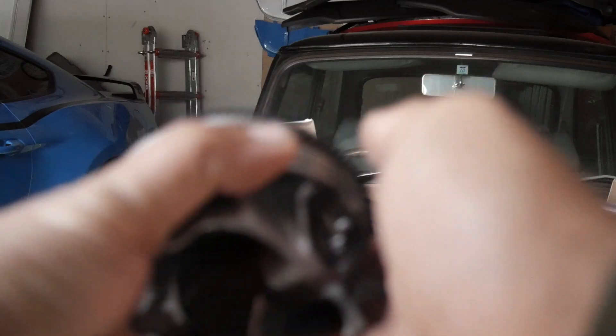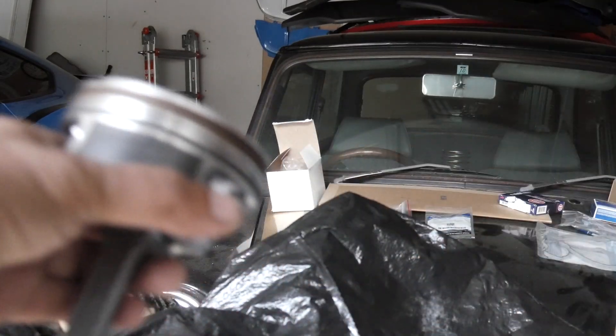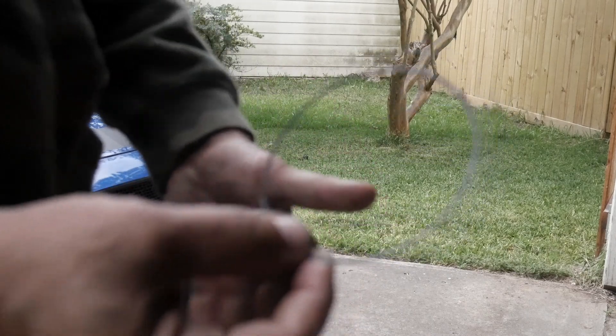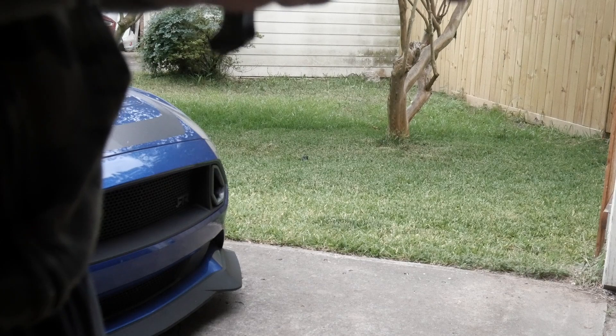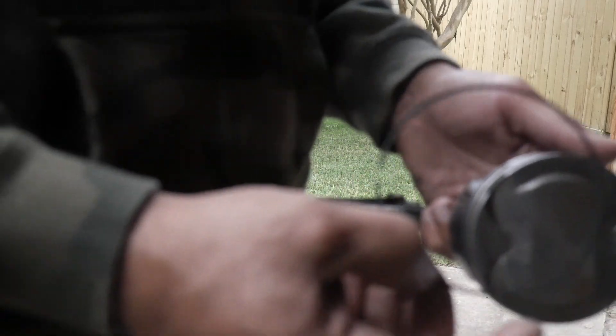Go ahead bring it all the way down here and drop it in. Next I like to move on to one of my oil rings. This thing is pretty easy to move around so we're not going to need the pliers for this one either. When I'm putting these on I kind of like to get everything set up to where it needs to be. There are people that say each ring needs to be at a certain degree or whatnot — I like to make sure that they're all 90 degrees apart. That's what I've seen before and that's what I kind of go by.